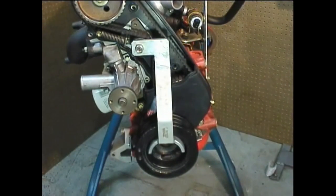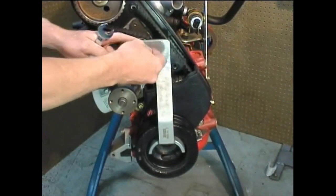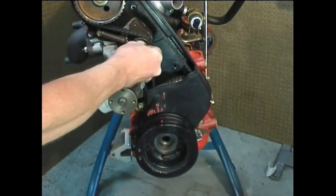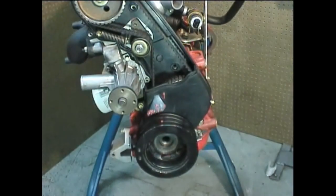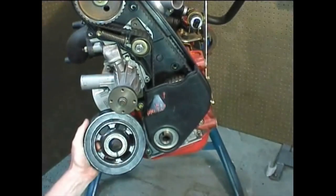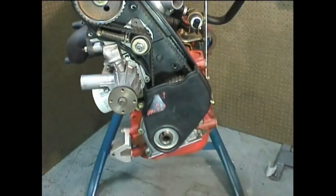The next step is to remove the counterstay by taking off the original tensioner nut. Remove the counterstay, temporarily reinstall the washer and nut on the tensioner, and remove the crankshaft pulley. Unlike many crankshafts, this one is not a tapered fit — it has a keyway at the bottom which fits snugly once the bolt is tightened. A slight tapping with a hammer may be necessary to remove it. Then remove the 12mm bolt and the 10mm bolt from the lower timing cover and the crankshaft washer.